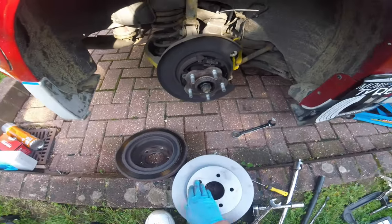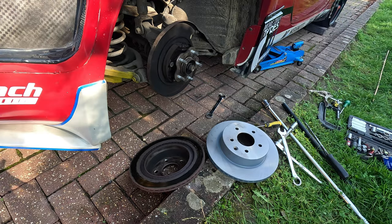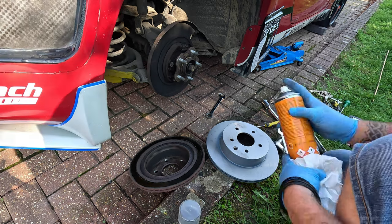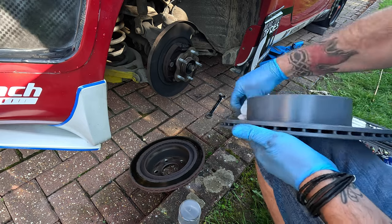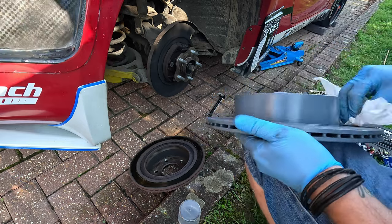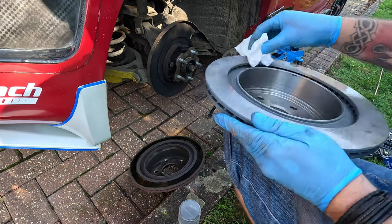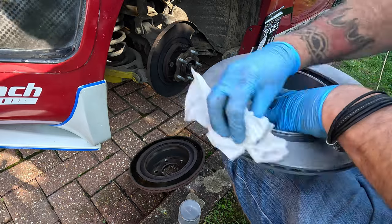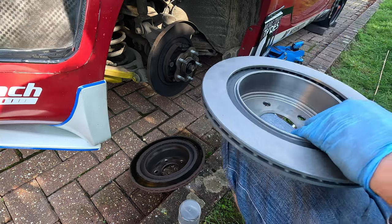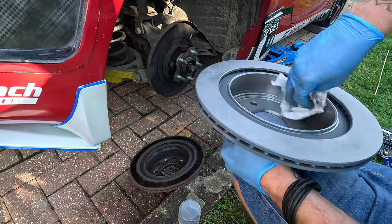What we need to do now is clean off — there's like a cover grease on it, we need to clean all that up. Normally you would use blue roll, but we're actually only using toilet roll. We're using a generic brake and clutch cleaner. Wipe the whole surface down, get all of the surface grease off — we don't want any of that on our braking system. Turn it over and do exactly the same for the back half. We're going to do the inside as well because this has got an inboard handbrake.